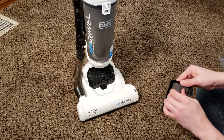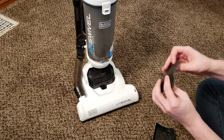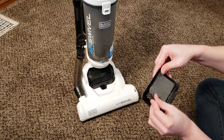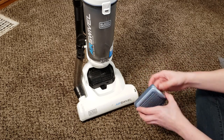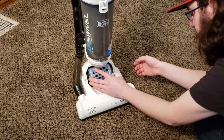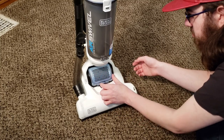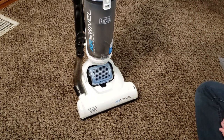The post-motor filter is basically two pieces — a squishy side and a coarse side. Wash them separately. If this filter separates after use, you'll need to replace it. When you put it back, place the squishy side facing out of the grill and push it in. It should push in with no problems — if it has any issues, just squeeze it in with your fingers. Make sure it's fully bone dry before installing. Line the grill up — it's a little tricky to line up, just wiggle it until it pops back into place. Once it feels firm and isn't jittering, move the lock into the lock position and wiggle it to confirm it's tight. Your filter is completely installed.